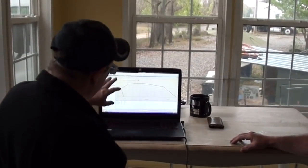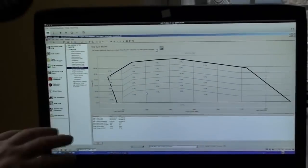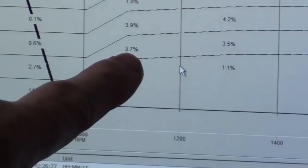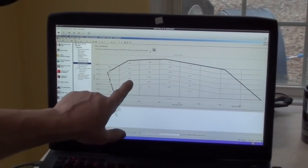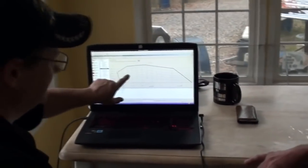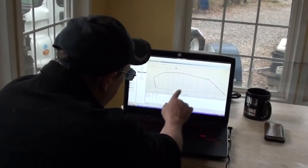This is the duty cycle monitor — I like this because it reveals a bit about how the truck was driven. With about 12,000 hours, remember this is from the old engine. You can see about 23 to 26 percent — close to 30% — in the low RPM region at 800 or less idle. You can see some operation under torque load, so somebody was driving up hills with their foot in the floor, not shifting gears as often as they should — but not too much, just a little here and there.